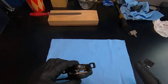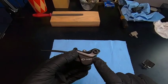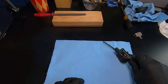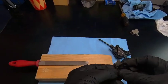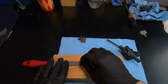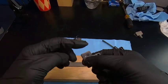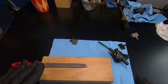After I did that, all of the squeaks went away — all of them. I think this is probably the problem on the majority of these Logan brakes. The tolerances on the sides of the brake pads just aren't very good. So you take the ones you've got, or the new ones you're going to put in, and you just hold them flat and take about a mil off of the side here and here, and it should take away all the sounds.